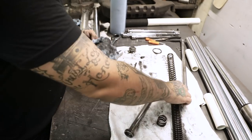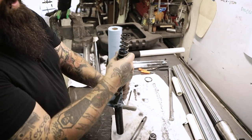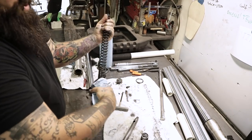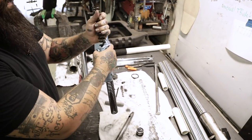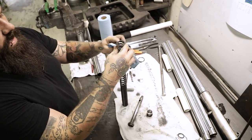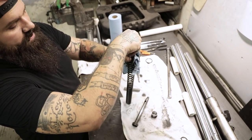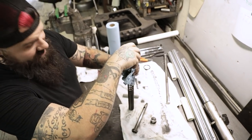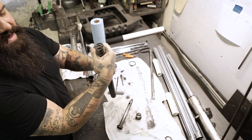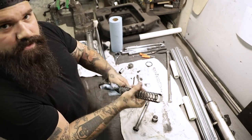If you've been riding a long time or the bike's really old, you may want to step up to progressive springs depending on your riding style. They're really nice and they improve the suspension a bit. Honda bikes are typically pretty mushy in the front end, but if you're riding a cruiser or a chopper, a little bit of comfort kind of helps, and having a soft front end is a good thing in that case.